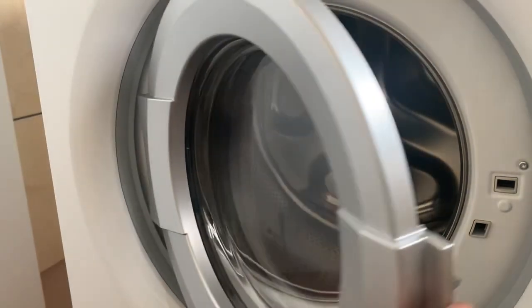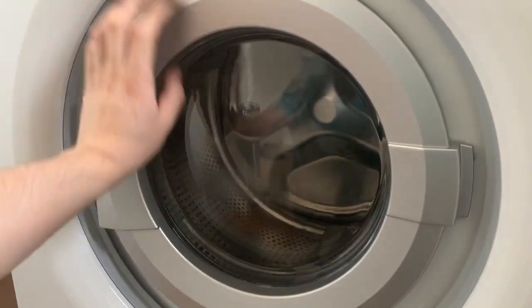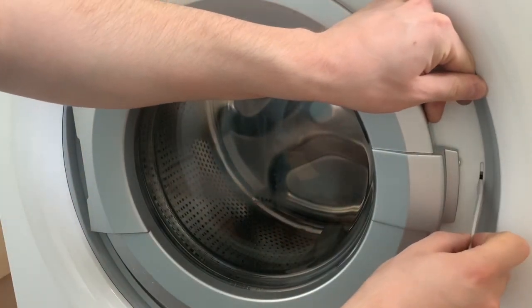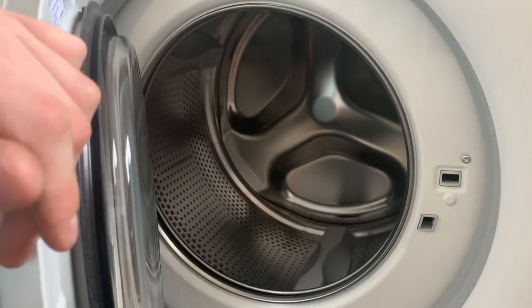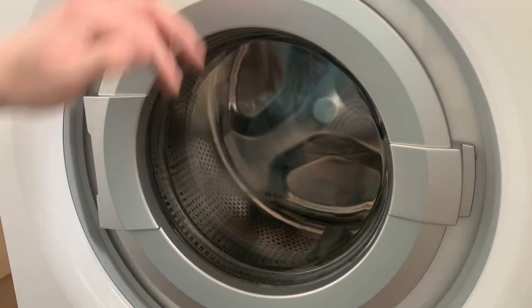As I was saying about the emergency door release, I'll close that. You can, no you can't. It's awkward to do with a camera in the way. You can just see this little slot in here. If we put that in there and go up like that, it'll flick the door open, as you saw. So I'll make a separate video on that, because that's quite useful if you don't know how to do that in a power failure. That's about it, really. Just a single skin door. A few cobwebs, but apart from that, and it is a plastic door.